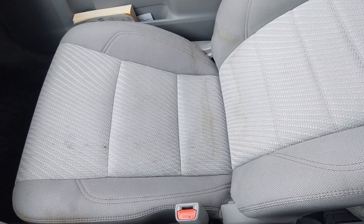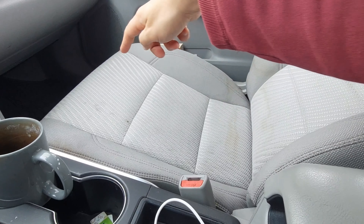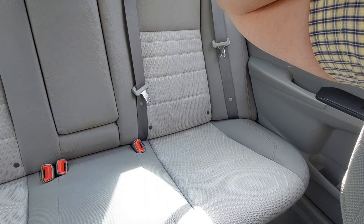This is what I was talking about earlier — this is going to be the last spot to dry at the bottom. Now it's completely dry and there's some residual stain because the water and the dirt runs downhill. That's top of the hill, that's bottom of the hill — that's what I mean. But this is really easy to take care of. Just get it wet with only water and there should be enough detergent in the fabric to suck it out, so no need to wet the whole seat — just the area with the residual stain. After it's wet, hit it with the machine and it is completely gone. Or almost.